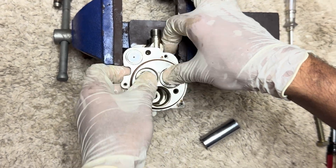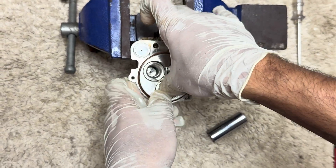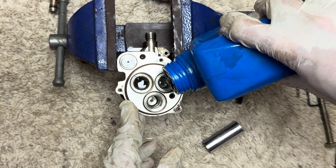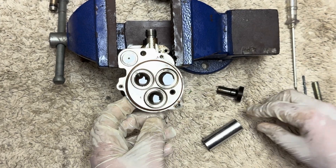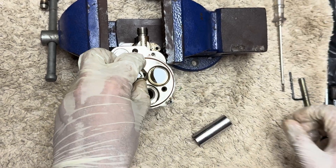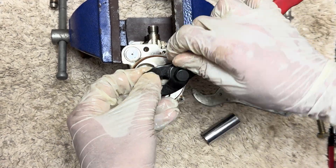Install all three. This time I have used 5W40 oil — last time I had used 0W20, so this should be fine. Once you fill the oil, make sure it's free from air, and just install the cap.